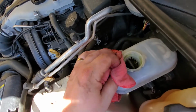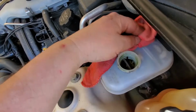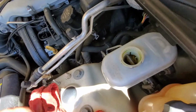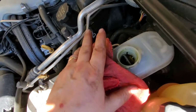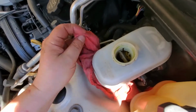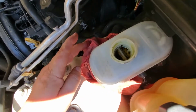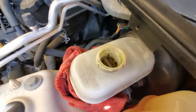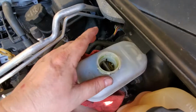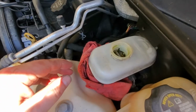Right, now you would think that you would want to put the lid on here. Actually, you don't. You want this to breathe. But because some of it may come up, I didn't really want to go this quite full. I'm going to put a rag down in here to try to catch. Probably need a bigger rag, son. That one that's on the ground over there probably work. You want to put a rag around here to catch any brake fluid that comes off so it doesn't eat the paint in your engine bay.